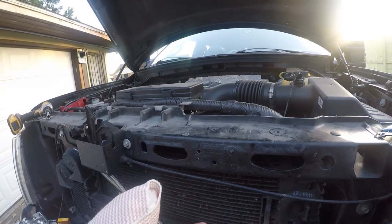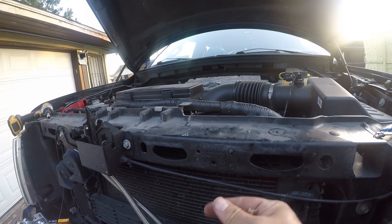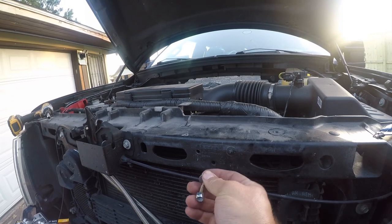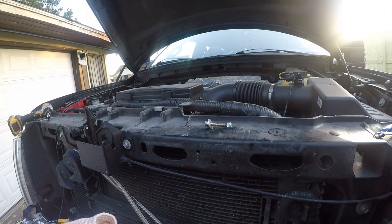So I'm going to use grade 8 1/4-20 bolts, and they're going to come through like this. The reason is that I've got a lock washer on this with a washer to back it up, and it'll bind on that side, allowing me to tighten it. Should be relatively easy, and the shoulder should not present a problem. We'll see.